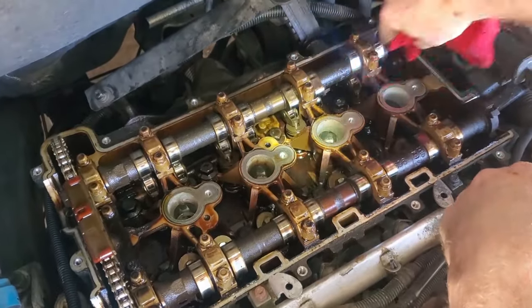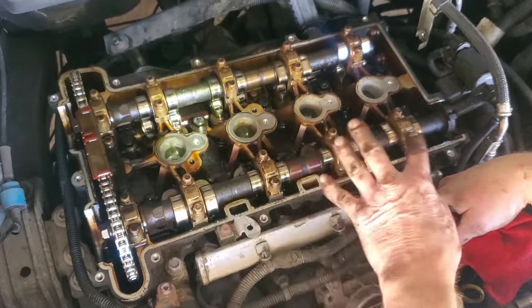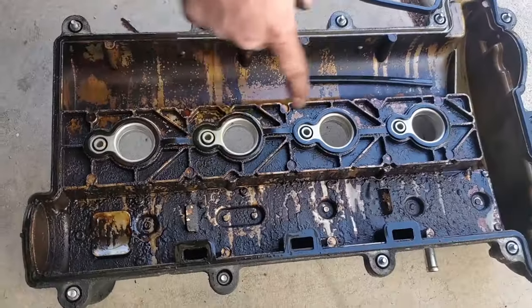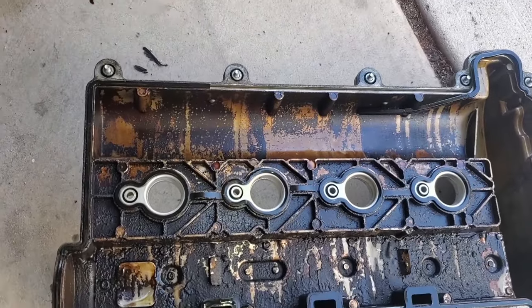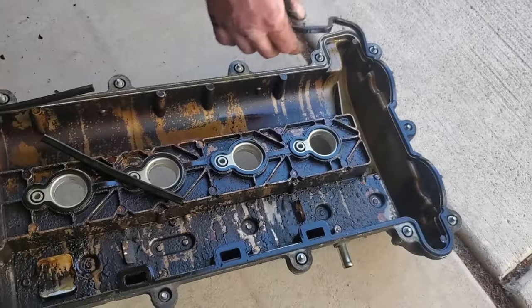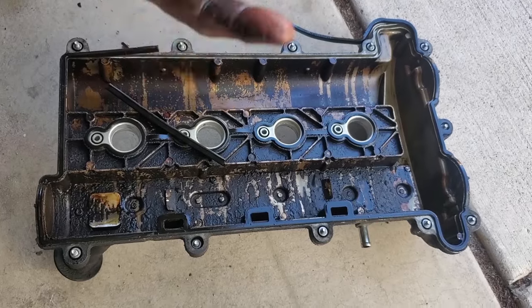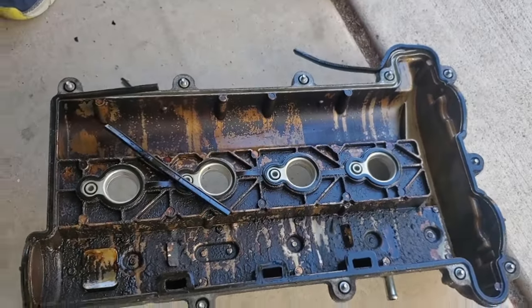This is a non-interference engine, so if one of these cams were to break you wouldn't lose your whole engine. We had a '96 Chevy Beretta where the in-block cam snapped in the middle — when the mechanic took the valve cover off you could see two of them were gone and the other one just wasn't working. Anyway, we're gonna go ahead and clean everything up — you see all this gunk and crap. We're gonna manually clean everything, put the new gasket inside, put the new grommets in. See this is the back of the gasket — the back was going to the engine because I pulled this part off the front. The front was okay, but this is what happened — it just dried up after 160,000 miles and the oil was leaking out here causing a big mess. I've been adding a lot of oil to this car.